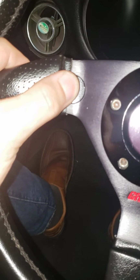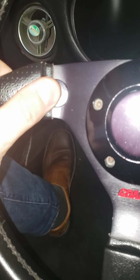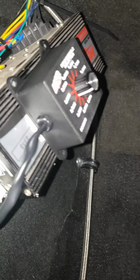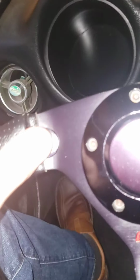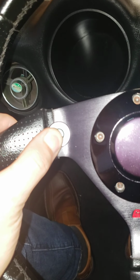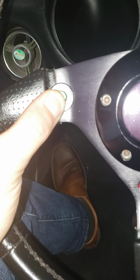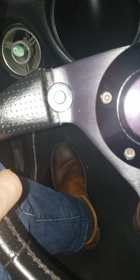And then this is your trans brake. So you set the trans brake. This is the two-step for that. So you set that over here, and then you put it to the floor, and then that way, whenever you want to go, you go. You're probably familiar with this. If it's Pro Tree, it goes stage, and then it goes yellow, and as soon as you see the yellow, you let go. By the time you let go, it has turned green. So anyway, that's an overview of the car.